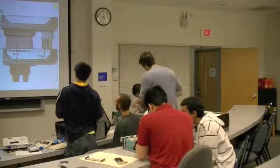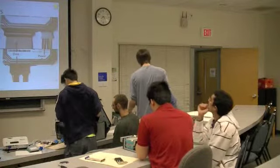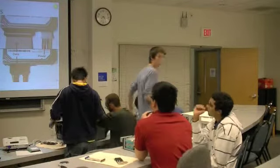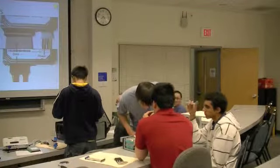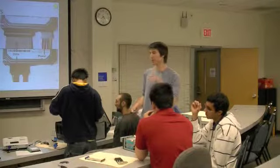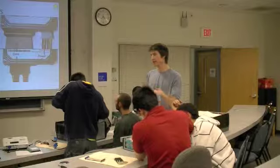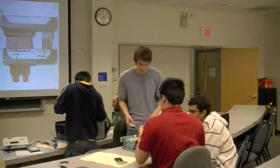Alright, so then the other thing I'm going to do. Yeah, it's a jumper. There's a thing called slave and master. It's referring to whether the drive is read as your primary or the secondary. It goes to the black connector. You want to make sure that it's plugged into the primary IDE. The secondary is going to be for your CD-ROM drives, for data and stuff like that.